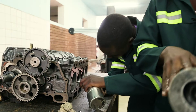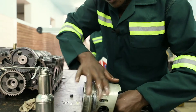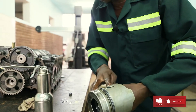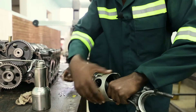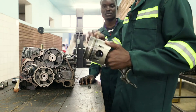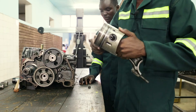The reason why we use the grease is to avoid friction. We have to avoid friction so that these parts can work the way they are supposed to work. Before we insert the piston, we have to space the ring gaps. The reason we space the ring gaps is to protect the compression that will be taking place during the compression stroke.